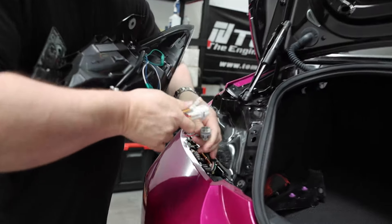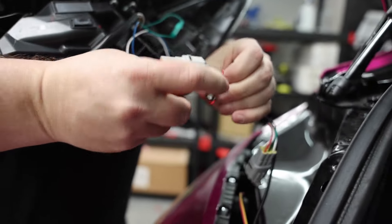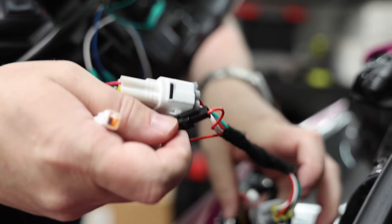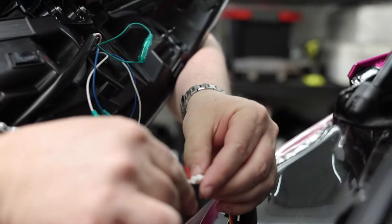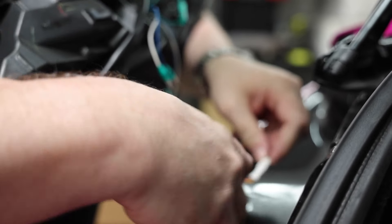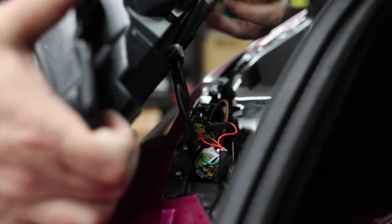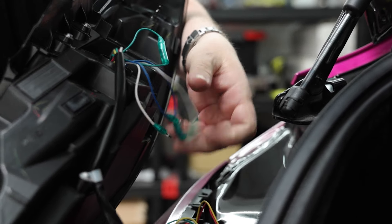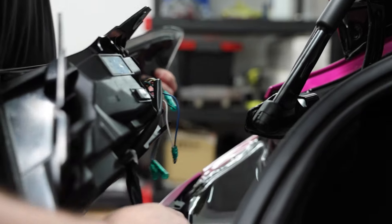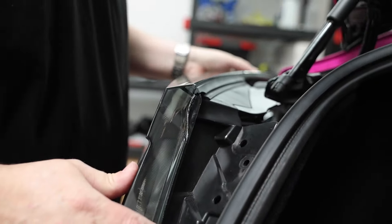I'm going to actually put our tail light in, plug it in, and leave it here. We'll put one of the bolts in, but I'm pretty sure I'm going to have to access this — I want to actually show you guys what this does. This is for the Valenti startup mode, so this has to get plugged back in as well. I'm just going to tuck this harness down in here and drop this tail light in. There are a bunch of different connections here for the Valenti tail lights — by unplugging and plugging these things in, it turns things on and off. So we're just going to get this all tucked right down underneath there.